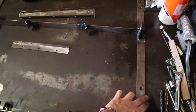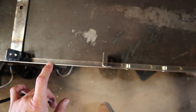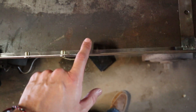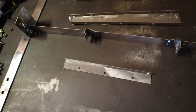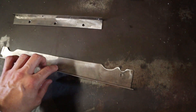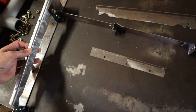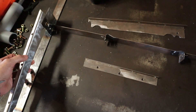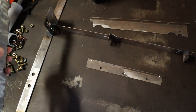So what we have is two strips that mount up to the radiator as our boundary. I ended up creating this bottom piece as well, which is welded in and directs airflow straight through the stack on the bottom portion. I went ahead and welded in tabs — these are for the fluid cooler — and tabs up here at the top as well, made slightly larger. These are the angled pieces I created to help direct the flow on the side. So these go on the outside and bolt up. The fluid cooler is right underneath there, so the airflow should go straight through that AC condenser, through the fluid coolers, and straight into the radiator without an issue.